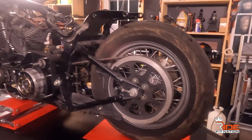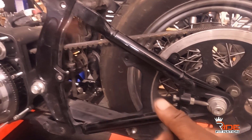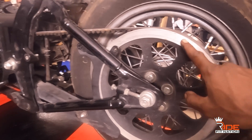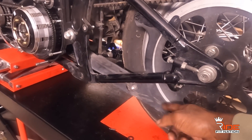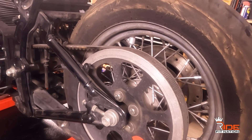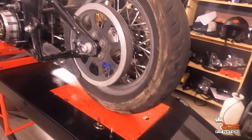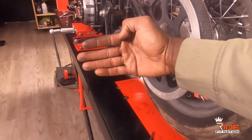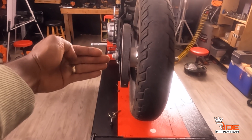Starting from the back: first, this is going to get shined up so I can see the frame. The belt is in immaculate condition. I'm taking the rear wheel off to change the tires and powder coat the whole thing. The rims will be 18-inch fat spokes in the back, probably a 140/70 rear tire. The rear fender is coming down to a six-inch drop. I'm debating putting the plate as a horizontal side plate rather than on the fender — let me know your thoughts.